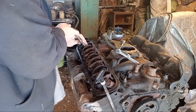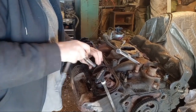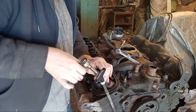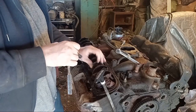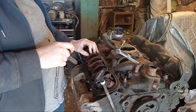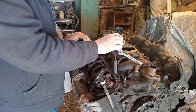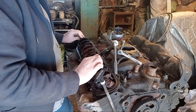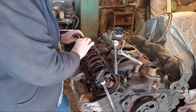Let's make sure we get all the tension off of them. When you tighten them, it's more critical to tighten them evenly than it is loosening, but still we're going to take precautions. No tension. Like I say, I've got the other heads and I've got another set of push rods. I don't know about rockers though - I'll have to check my stash. I don't think I've got another engine I can take apart just for the rockers. I'm amazed this thing ran, y'all. I really am.